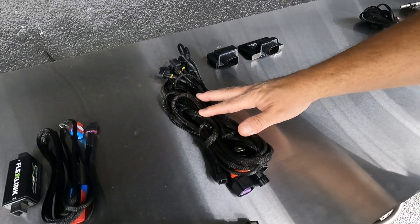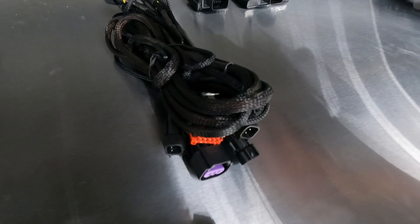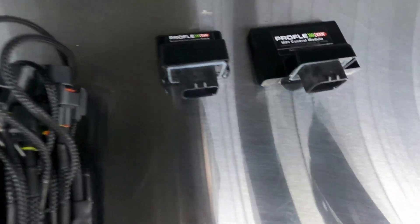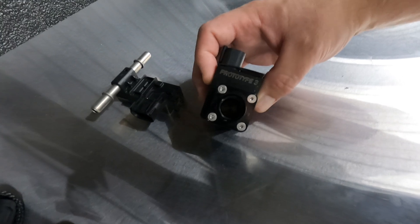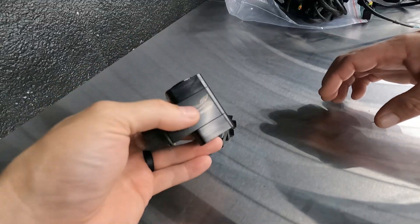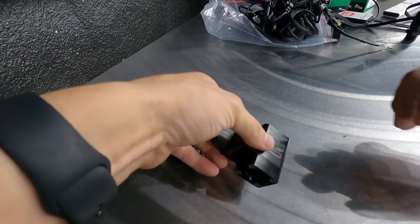This here is for our Commander systems, which is plug and play FlexFuel for Corvettes, Camaros, Mustangs, all your Mopar products — and this will allow you to run FlexFuel without any tuning. It's just plug and play. Also over here we have our DX module — this is our direct injection controller. We use these on some private label stuff and on the newer Mustangs that have both port and direct injection. And over here we actually have our own sensor that we've been developing. Most people are familiar with the GM sensor, but this sensor has much greater flow. We can flow up to dash-12 with no restrictions, unlike the GM sensor which is very restrictive — it was honestly designed for an Impala. We have all the different kinds of fittings for it: quick connects and any style AN fitting you would want, so it can integrate easily into whatever you're running.